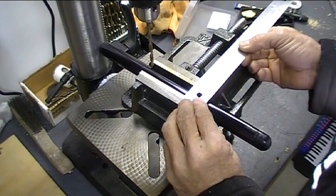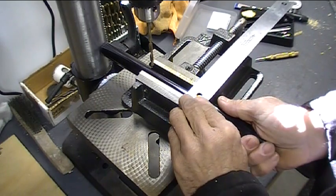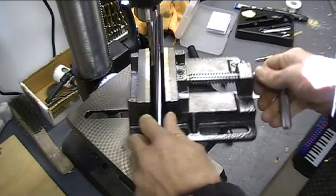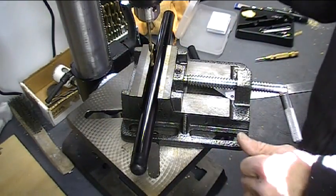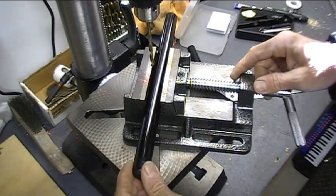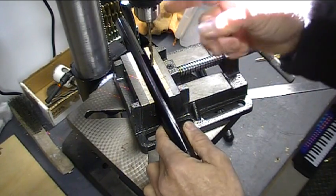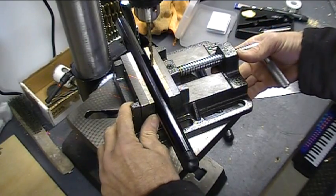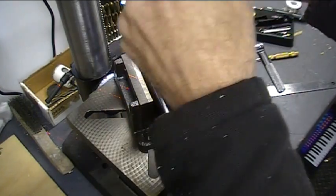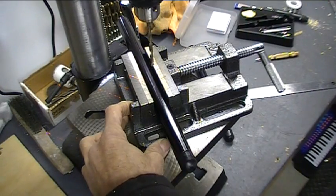These bars measure about 22 millimeters, though I need to have my center punch hole lined up at about 11 millimeters. There we go. Now this drill press, even though it's an inexpensive drill press, has a nifty little laser sighting device on it. So where the crosshairs meet is where the drill will end up. It's pretty handy. Works pretty well. So there, I'm lined up. And bring this down, it should be right on the hole. Yep, let's drill that hole.